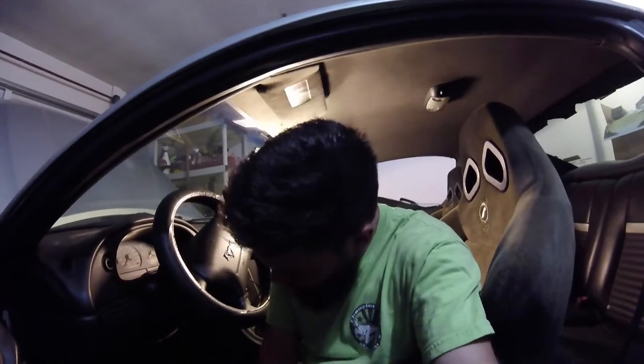So I can run the wiring for the gauge a little bit easier because there's quite a bit of wiring to do to get that to work, and it gives me access to the fuse box right there. That'll be really easy to get a constant power, which you obviously need. There are some good ground spots down there too — it says recommended to ground to the battery, but as long as you get metal on metal, you're fine.